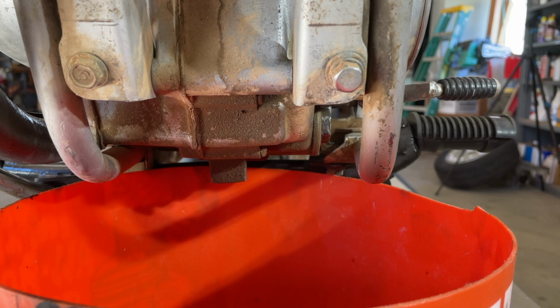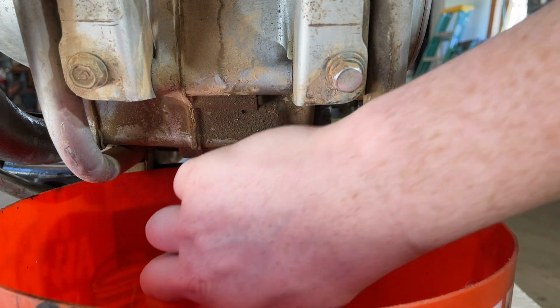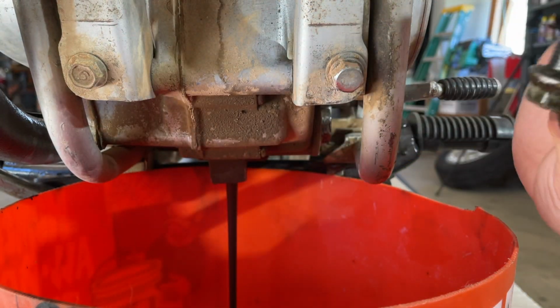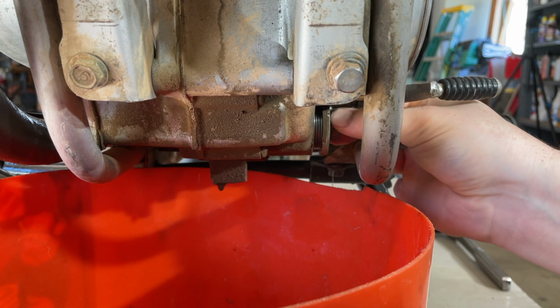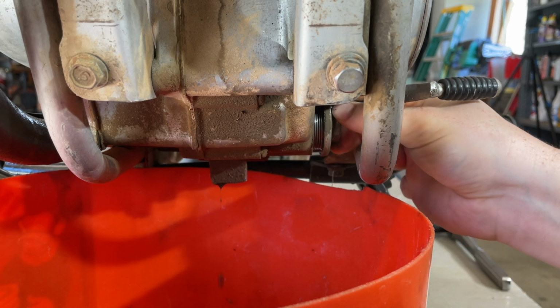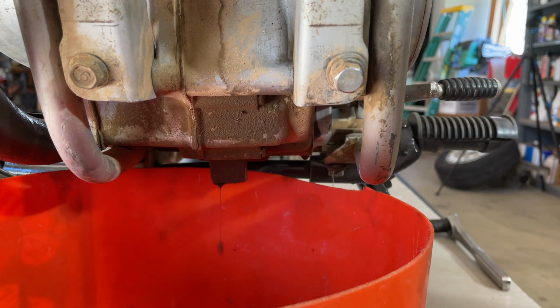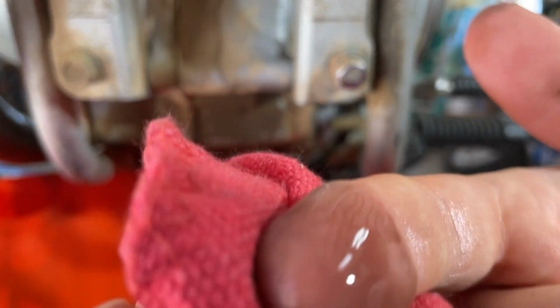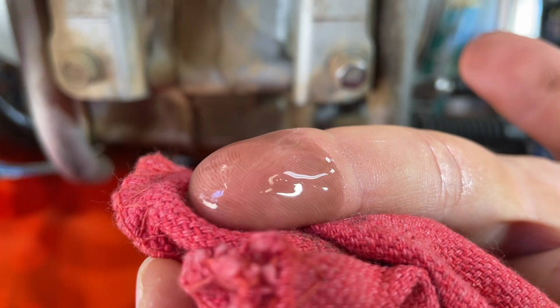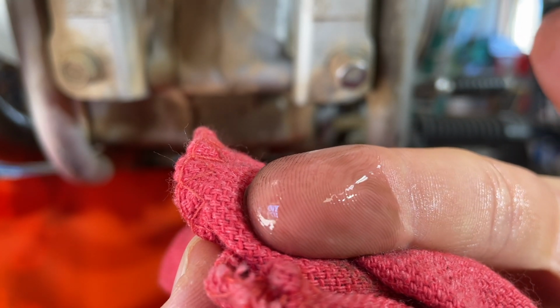All right, oil change. Looks like it had a decent amount of oil in there, that's good. And it's not black. Screen on a spring. You know, that oil is really gray, like, hate to say it, but like metal. It's so small, but I don't know if you can see any of them, but I think that I see some metal fragments. Aluminum, super tiny.